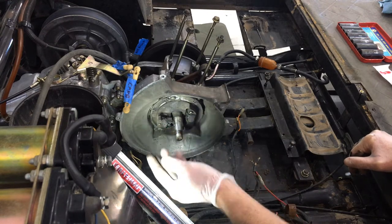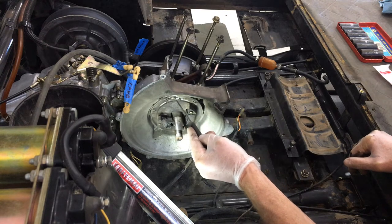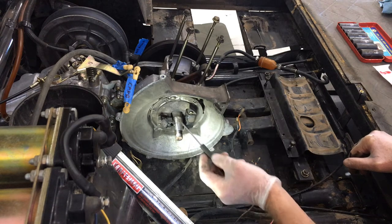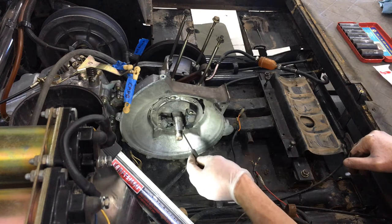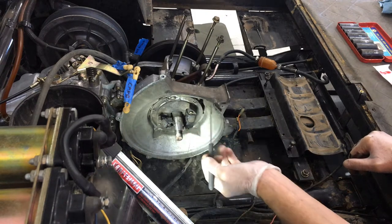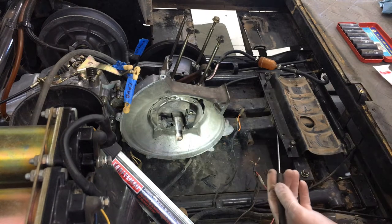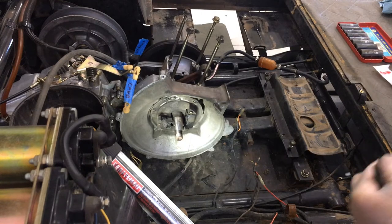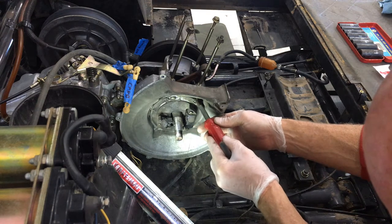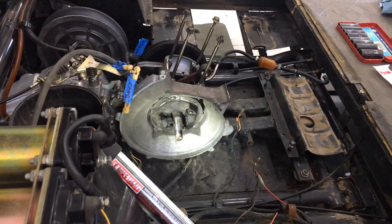You scribe to indicate the position of the plate in relation to the crankcase itself. I've taken a sharp pick and went all the way around both the top bolt and the bottom bolt - in this case it's a Phillips screw. I've also taken a close-up picture of this slot here, which I think is used with a screwdriver to help rotate the plate when you're trying to set the timing.